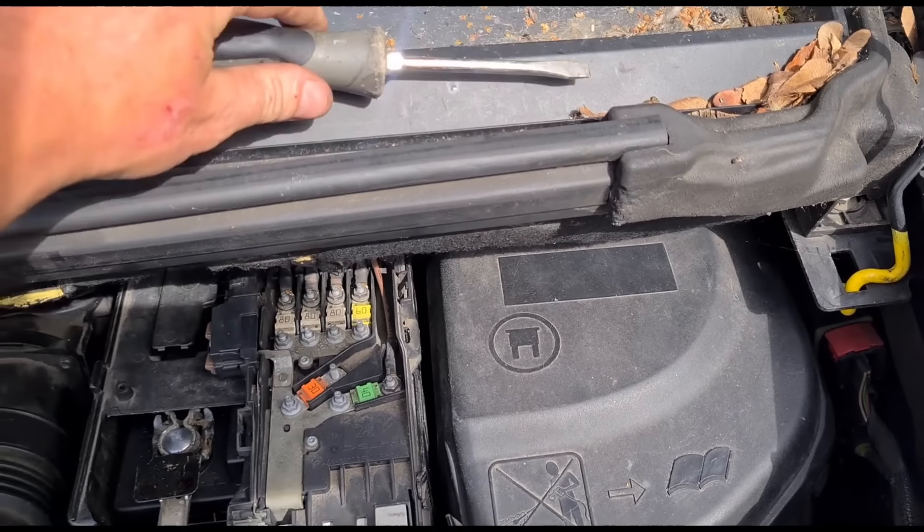Get those tightened back in and set up our multimeter. We check here — 11.8 volts. Now let's check the other side — 11.8 as well. So now I'm pretty confident this car should start. We are getting voltage across both sides now, so this should be fine. Let's go inside.